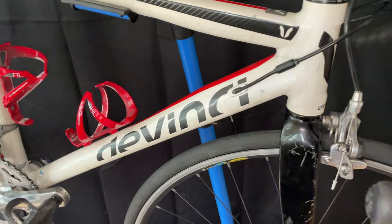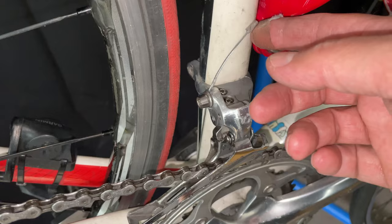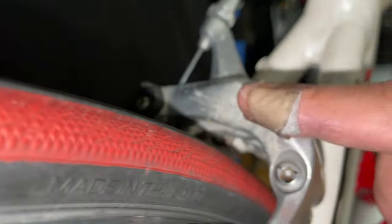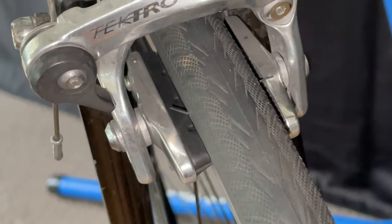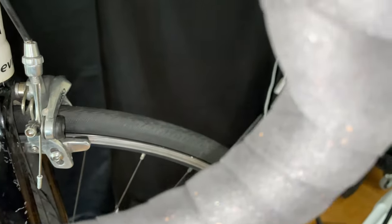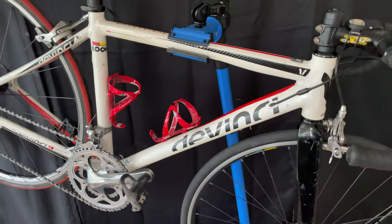The bike's all done. I added the inline barrel adjuster which adds value and improves shifting. I changed the front derailleur cable, lubed the chain, tightened the rear derailleur cable. I changed the cable on the rear brake — no more seizing. I made sure the seat post moves, adjusted the headset preload, did the front brake pads, and the bar tape looks really good — even wraps with no clamp showing on either side. It didn't take too much to get this bike back on the road.